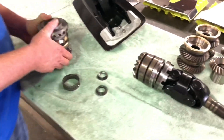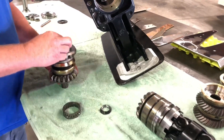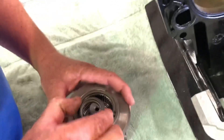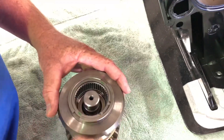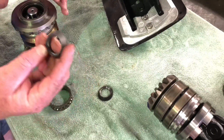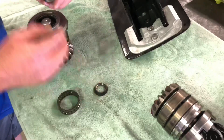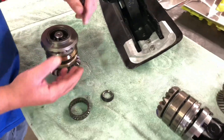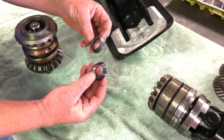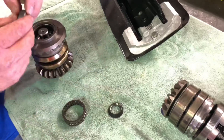One other important piece goes with that, and that's the collar for the clutch shaft. That's what ties — along with some keepers — the whole stack together as one unit. We make a heavy-duty billet version in a way better alloy. You want to put that on there because if that cracks and splits, then your stack comes apart and wipes everything else out. It's one more piece we use all the way down to the smallest component because it's super important.